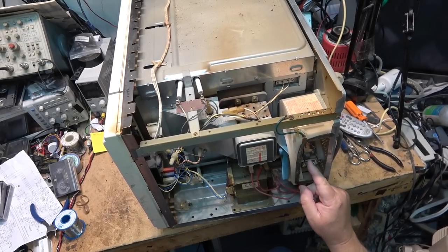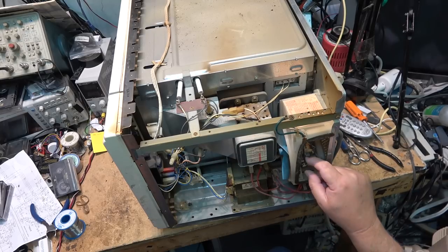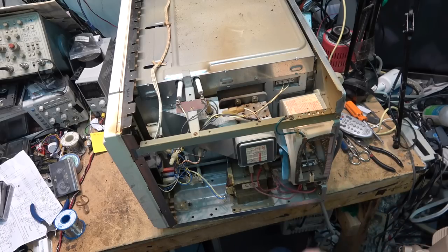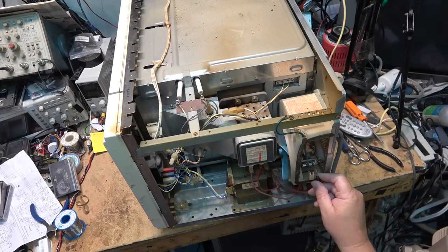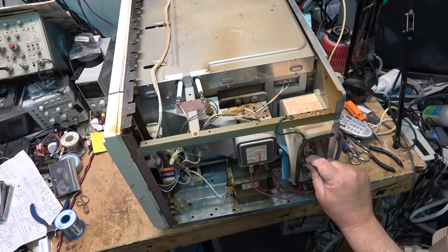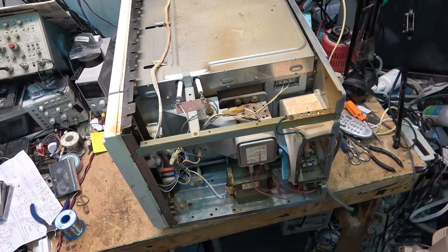Power cord comes in, it goes to a fuse. The fuse is not blown, so I'm going to unplug the power cord here and just measure it again. Maybe the power cord's gone bad - highly unlikely, but the fact that the 15-amp fuse didn't blow means you have to rule everything out. The cord is not damaged, and we still have our short measuring from neutral. The fuse is fine - the fuse didn't blow, it tripped the breaker. So we have to check the switches.